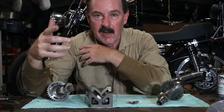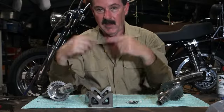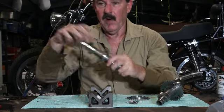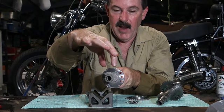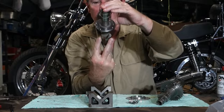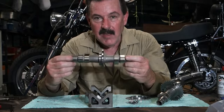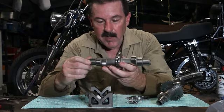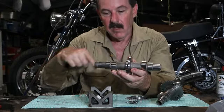It has a 90 degree crank in it, or a 270, call it what you like, they're the same thing. Whereas the stock engine has a 360 degree crank, and so the cylinders fire alternately at even intervals, you would find that on a stock cam you would have two lobes here, and the other 2 lobes would be here, right? In other words, opposite. So the engine is quite easy to turn over with the spark plugs out. The only resistance to turning over is the valve springs, and because the valve events happen evenly, there's an even effort required to turn the engine over.